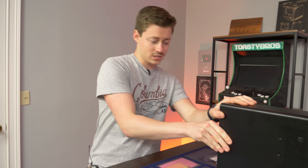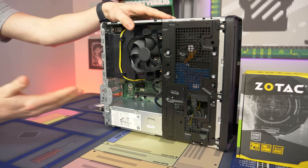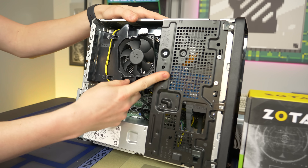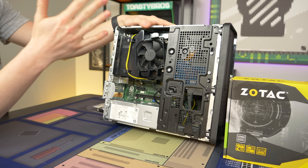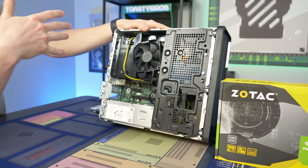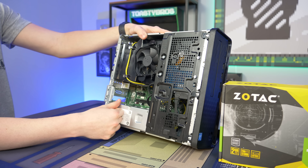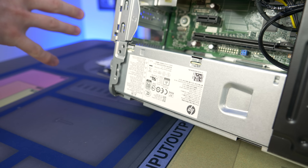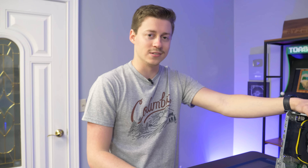This is an HP Slimline — one of their very small computers that is still upgradeable, because if you go any smaller you're in mini PC territory. It comes with a one terabyte hard drive, a DVD drive, and a Celeron processor which is just a dual core with no threading. It's on their 10th gen platform so it does have an upgrade path — you can go to an i3 or a Pentium like we went with. But you only have a 180 watt power supply, so you have to be really careful about the upgrades you choose. If we went with an i3 and a 1050 Ti, it probably wouldn't work — you might get black screens, blue screens, all kinds of colorful screens when gaming.